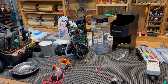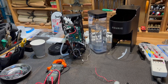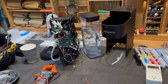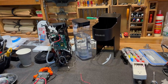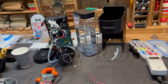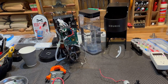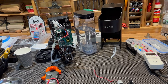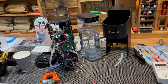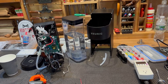I'm working on this Keurig coffee maker that just stopped working one day — no power at all. We tested all the electricals and everything's fine. It turns out there is a thermal shutoff switch in this thing that, if it gets too hot, it cuts all power. That thing had tripped because it got too hot, and it's resettable — kind of like those ones on a gas-fired hot air furnace where once it cools down, you just click it back on and it goes.